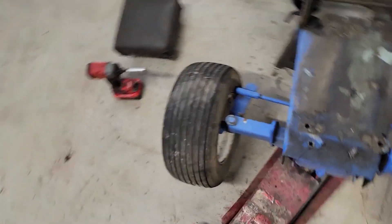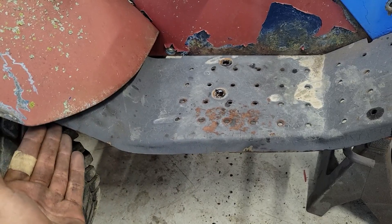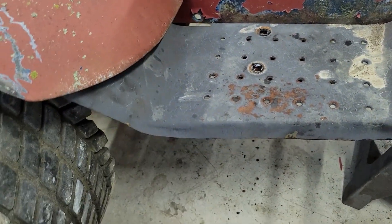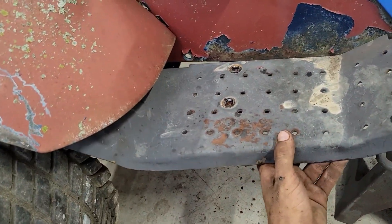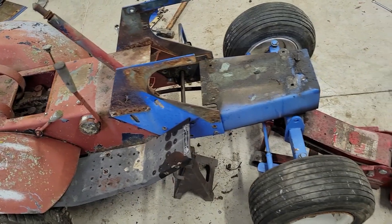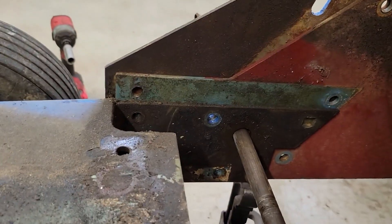Something I noticed that I wasn't planning on — and it kind of sucks — I thought these floorboards were going to somewhat line up. But it turns out that if it's a stick shift, the floorboard is quite a bit longer than a hydro. I was expecting to have to cut basically right here, but it looks like everything is completely different. I'm probably just going to use these normal stick shift style floorboards and put them on like that. I was pretty sure I was going to have to drill some holes right there and right there, since this is an older frame compared to this part, and you can see on the inside that it doesn't quite line up.